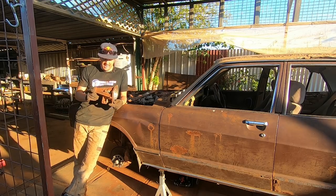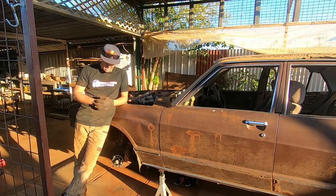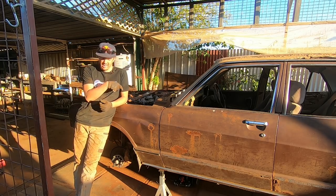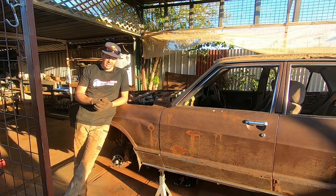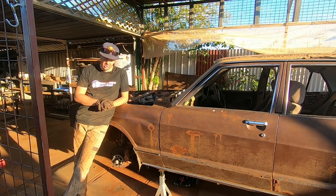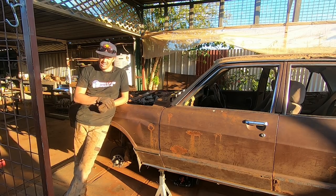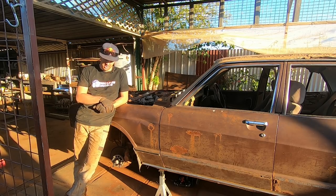So you know how we just spent ages trying to get this out? And that's about how much it's worth to us. It turns out that the G220 and the B8 has a completely different kind of transmission to all the other Falcons. And so, well, the EL rear housing part is held on by 4 bolts. The one for this transmission that we're running is held on by 10 bolts. It's also longer than that one. So there's no direct replacement for it.